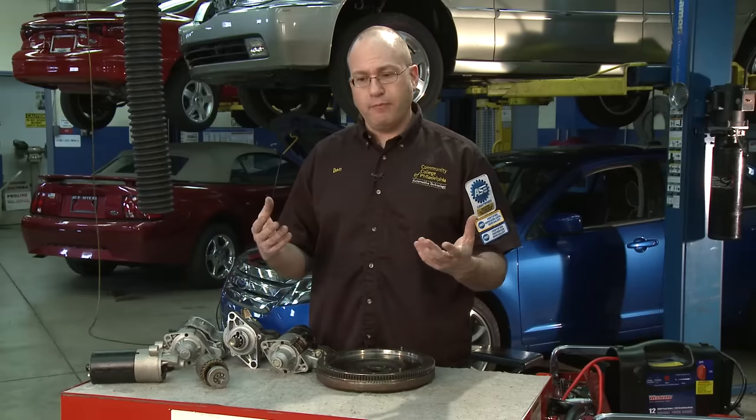Some vehicles have a separate starter relay. The starter relay may be part of the anti-theft or alarm system — if the car alarm goes off, the system deactivates the starter relay, so even if you hot-wired the car, you may have bypassed the ignition equipment but the starter relay further prevents the starter from functioning. In terms of getting the starter to function, there are three switches that have to close first before we actually engage the starter motor. The last thing we have is our starter motor with the starter solenoid and the pins on the back: the S-wire, which is the signal from the ignition key and neutral safety switch; the B-wire; and the M-wire.